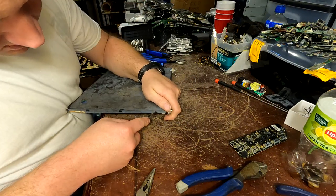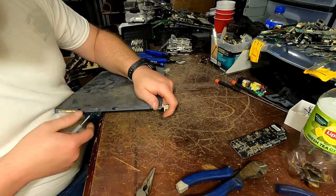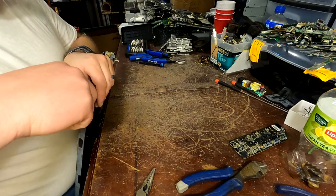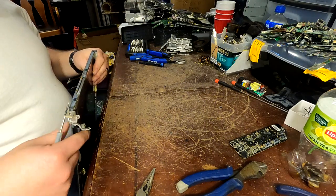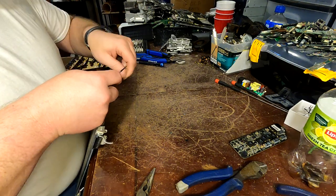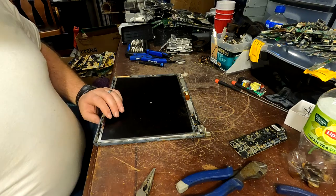There's what it is — these spots right here. You're not doing any good work if you haven't stabbed yourself with a screwdriver a few times. As you can see, there's a screw in it right here. I'm going to pop these off and get these screws out. You don't normally have this on a computer screen, but every now and then you do — it seems to be more related to how old the laptop is. Most of your new ones just kind of pop in and out without much of a problem. I believe that's aluminum — not positive, but we'll find out in a minute.